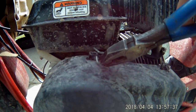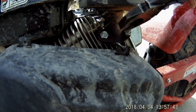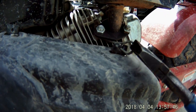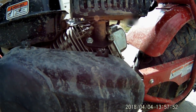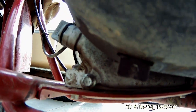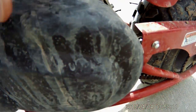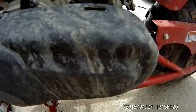I'm going to try to do this one-handed without dumping the bike over on me. So to access your centrifugal clutch, this is really all it takes. Just pull your cotter keys out, switch hands with the camera, and I'll try to show the underside. Just have these tabs that go through this cover — pull that up and over each tab, and then it'll just drop off the bottom.